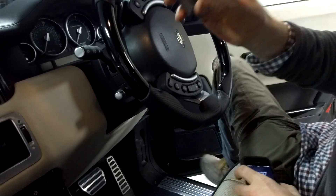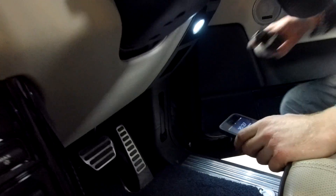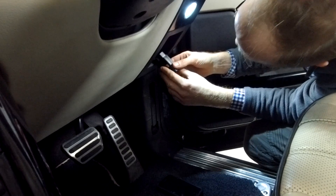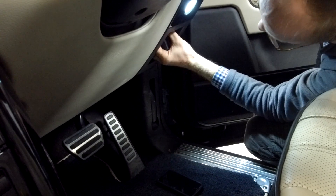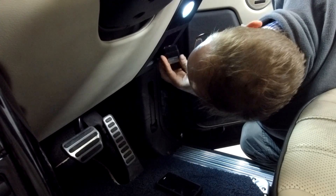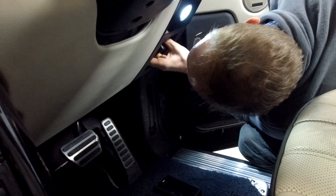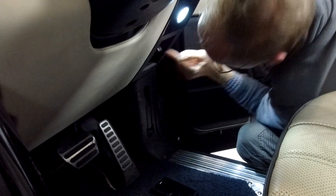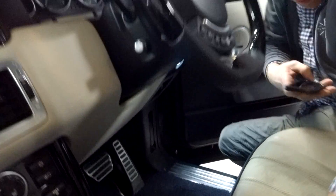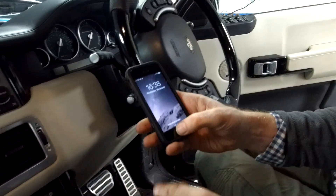So there's your little IID Bluetooth dongle. You stick that into the OBD2 port which is under here — straight up in there. It should light up when connected correctly. There you go, some little lights going on. Then you download the app — I've done a separate video about how you install it all.